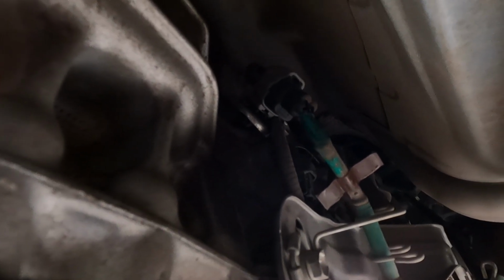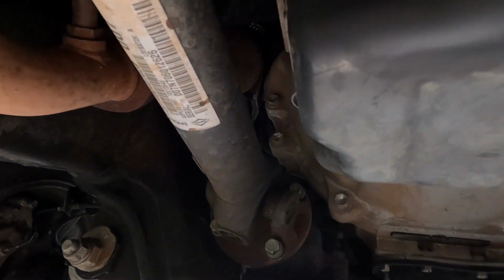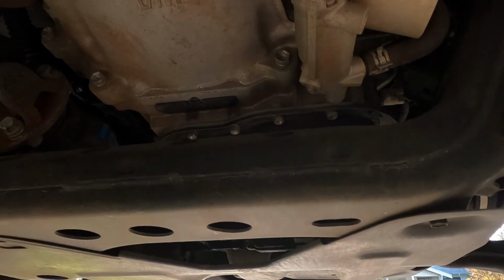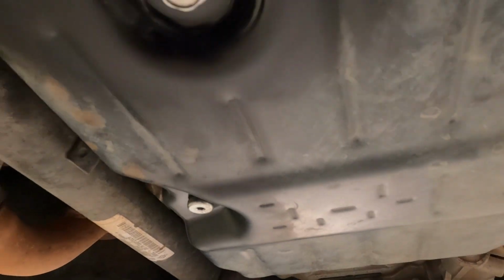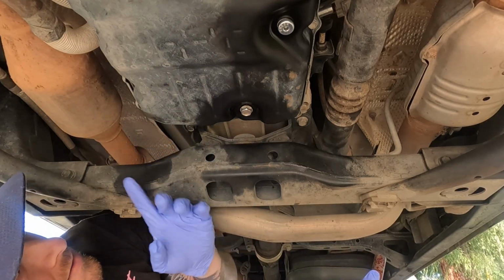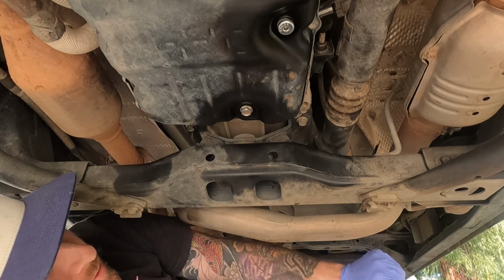So all right, let's get into it. This little green connector to the left, you'll see a little 24mm bolt. You want to crack that first, make sure you can get it free. It's good practice. This is going to be the 5mm check bolt, and that's your drain bolt. Your engine's up here. If you're doing an engine oil change, don't make that mistake. The truck's cold. We already cracked our 24mm fill bolt at the top.